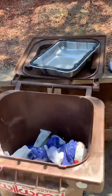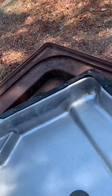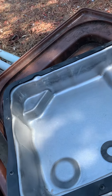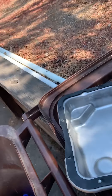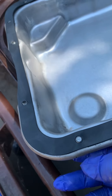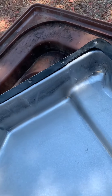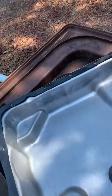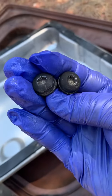I get it clean and clean everything up so it's fresh. Clean the magnet off — there's a little bit of clutch material, a very normal amount. These bolts will hold the pan in place; just screw them in two turns. Sometimes something will fall out as you tighten them up, but it helps you know that you've got them all. Then I also clean the T40 torx bolts.